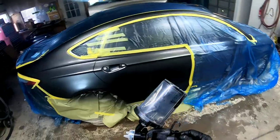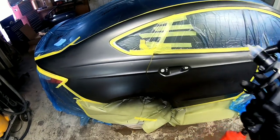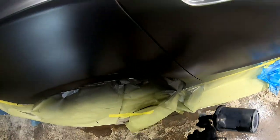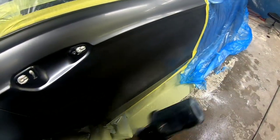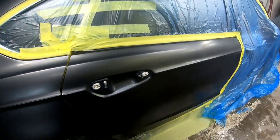You could take it one step further and reduce your paint about 15%, then spray an orientation coat on it. That makes the paint more translucent so it won't cover as well, and it'll give you a good transitional blend.